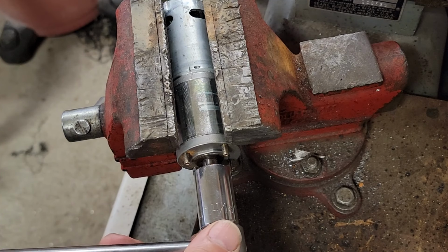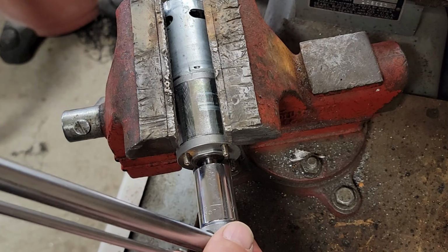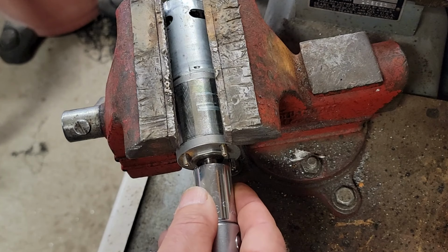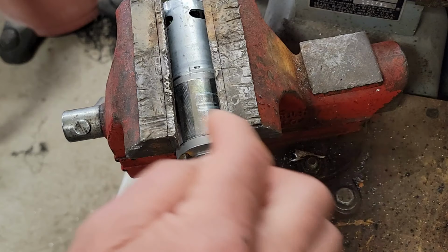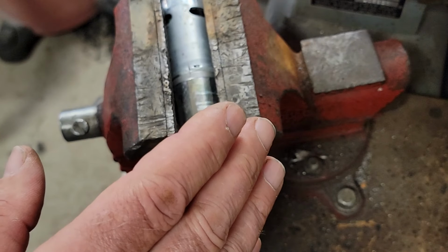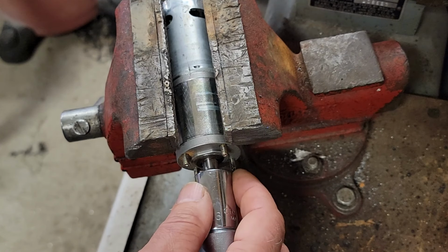It turns out, when you move it clockwise, it can take as much as 25 foot-pounds to turn it. And when you go the other way, it's more like 10 foot-pounds. Now in our case, we were pushing the slide out, which was causing the motor to turn counterclockwise. So that was the value we were seeing. If you're pushing this thing back in, you'd have over 2.5 times as much motor resistive force as trying to push it out.